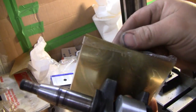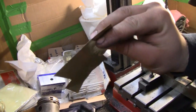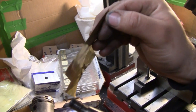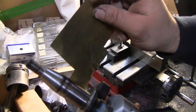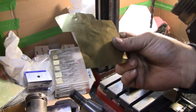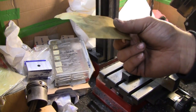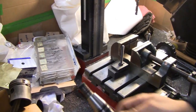And then I'm going to cut some brass shim stock here and fill up the rest. This is pretty thin stuff. So that's going to make up the rest of it. Should need, with that aluminum, one on each side, and that should be all right. I have to do a little bit of filing on the aluminum, just take a hair off, but that should be able to do it.